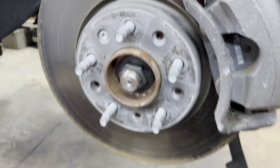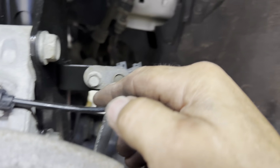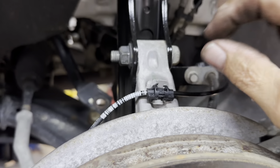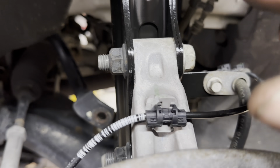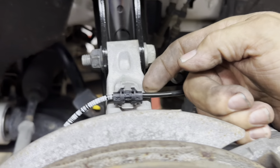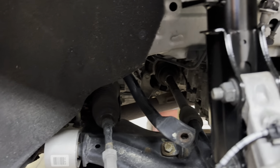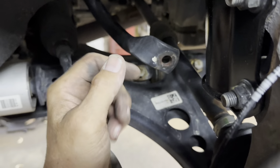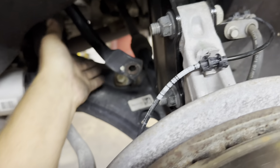Put your 10 millimeter back on for your brake hose and wire harness. If you undid this connector, find the fat part of the black piece and roll it underneath the gray — the gray is a little bit bigger, so find that opening, stick it in, and roll it so the thick black part is in the back. Next, do the stabilizer links — do the bottom first on both sides so you can push it around for better access.